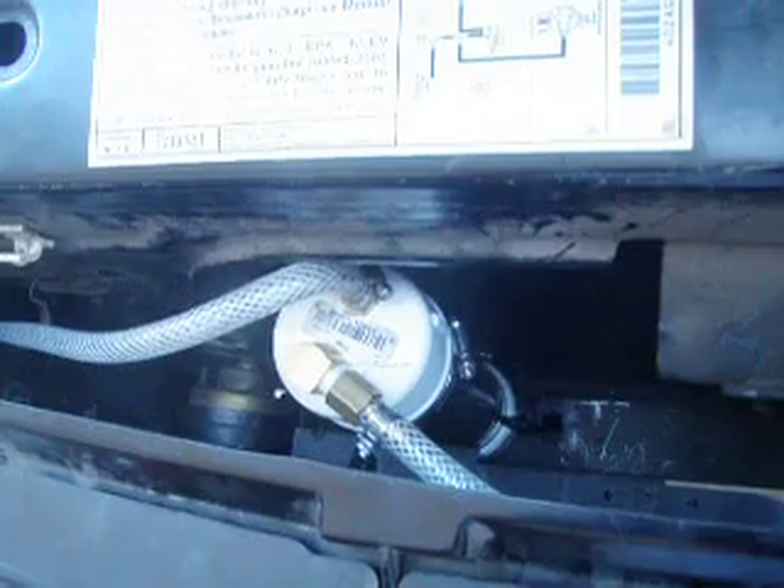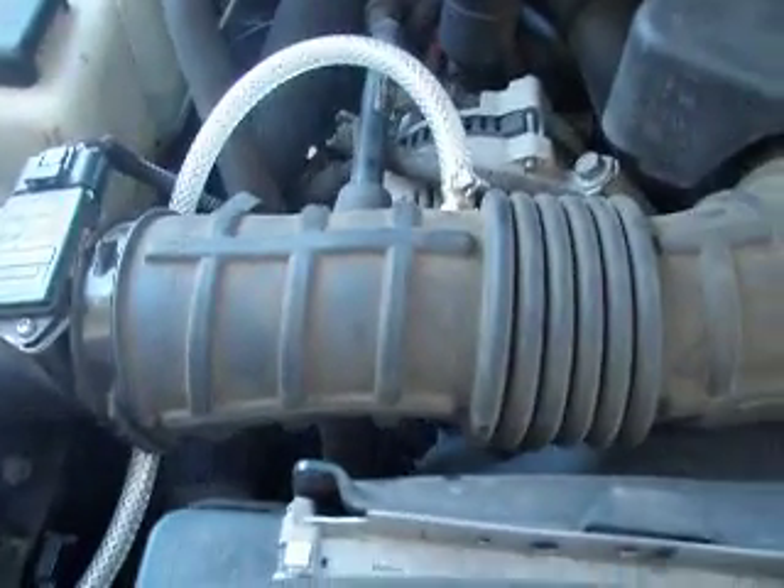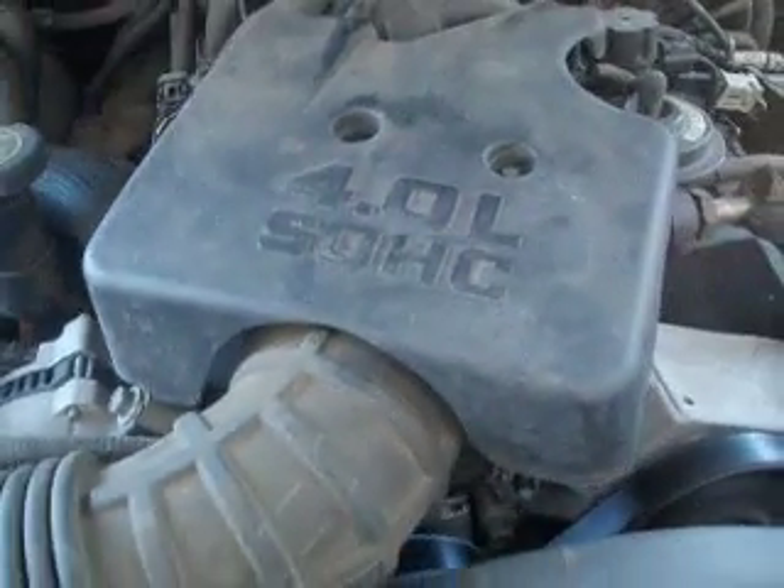Here it is running in system. You can't see it right now, but I have it running through here and then in through my bubbler system, which is just PVC piping I kind of made. I ran it up through here, after my air mass flow sensor but before my throttle body, which is underneath here.